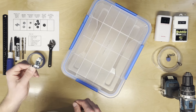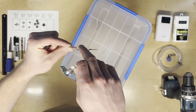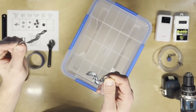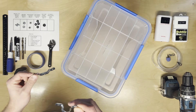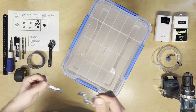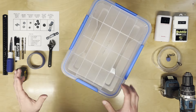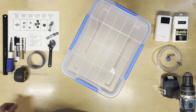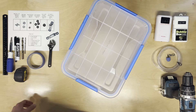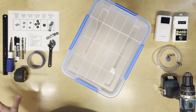We're going to take a half-inch conduit strap for electrical conduit, modify it, and turn it into a bracket so your bubbler can just slide right on. I'll show a clip of me modifying it at the end of the video. All you need is a hammer and a pair of pliers. All those parts cost about seven bucks for stainless steel, less if you go with zinc. In total it's around seventeen dollars — twenty for the bigger box — a steal for how nice this bait well turns out.